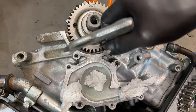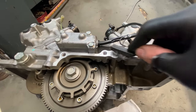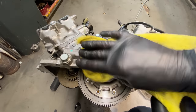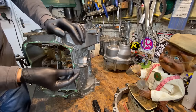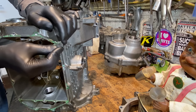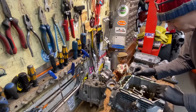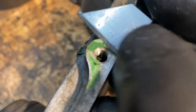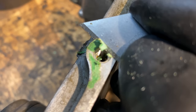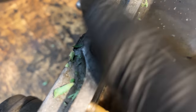With the front surfaces clean I give it a blow off with an airline and turn it over to look at the back surface. This is much better — the gearbox joint has barely got any sealer on it at all and just scrapes up very easily. A quick wipe with a rag and it's good to go. Now I can concentrate on the lower sump casing. This has got green gasket remnants on all the surfaces — top, bottom and ends. It takes a considerable amount of time to clean it off; you've got to just persevere, do a little bit at a time, have a cup of tea, come back and carry on. Eventually it'll be like new — clean it all off with some cleaner and blow it through with an airline and it's ready to go back together. I like to clean parts up as I'm going along when I'm working on an engine — that way it's not one big onerous task at the end. There are so many gasket surfaces on these Honda engines to clean, so doing it a bit at a time certainly breaks it up.